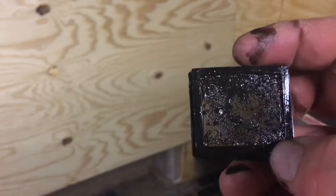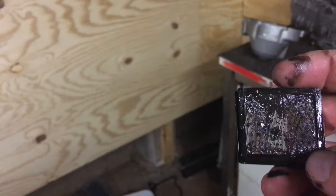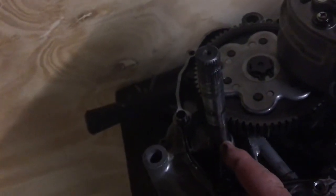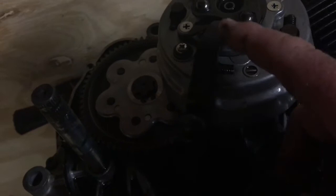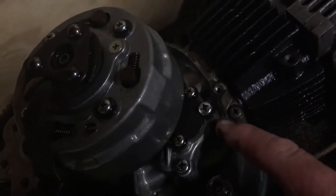What I do is I clean that out completely and reinstall it. I'll clean up all that — any gunk I can get through here, I'll clean it all out. Obviously this is your kickstart shaft that runs through. That's a gear selector that comes through there from the other side, turns this to the gear. That's your oil pump in here. There's the drum here that sort of kicks over for the gear selector.